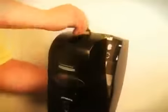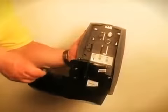Open the dispenser cover by inserting the key in the slots on the top cover and depressing the latch. If push button operation is desired, remove the decorative hole cap from the top of the dispenser by pressing downward to dislodge the cap from the inside of the dispenser.